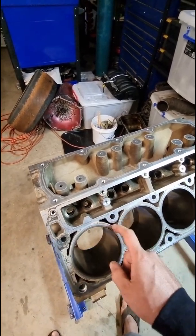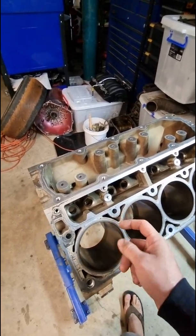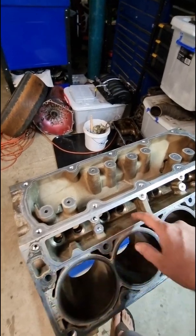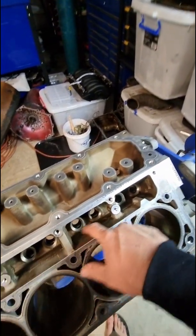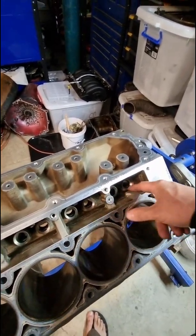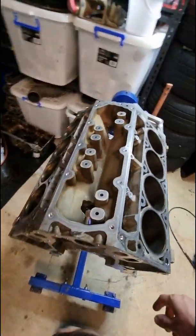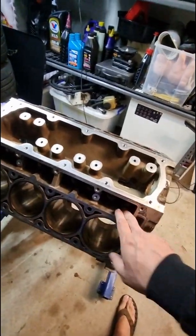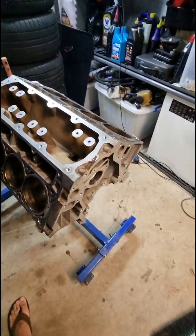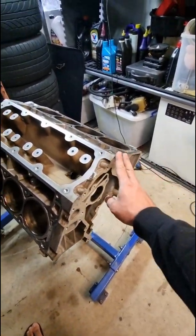Not too worried about burrs and stuff ending up in the coolant, which it shouldn't, but I'm also worried about the oil. Just modifying it — less vibrations and whatnot — little bits and pieces could come off, might make no difference at all, but it's just a little bit of finesse, tidying stuff up. I'll put this on time-lapse and show you — I'll go around all the outsides of the block, any sharp edges, anywhere. Just makes it nicer to handle as well.